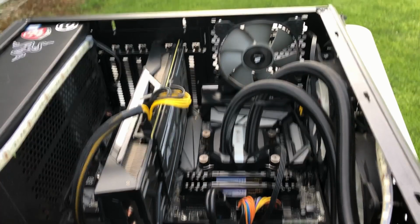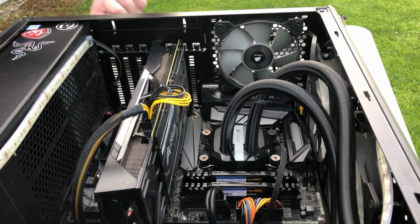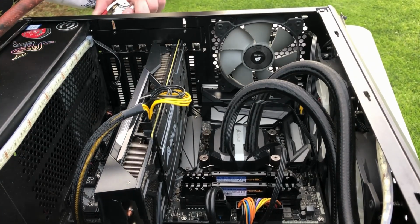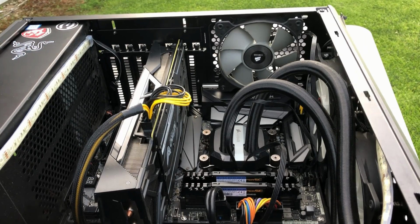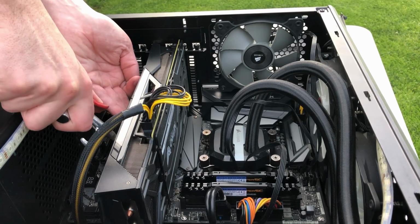So here I usually take the air compressor and go around the inside and the back of the fans and try to get into the power supply here. I usually stick something kind of small in to stop the fan from spinning in the power supply when I blow it out, so that it's not wearing out the fans too quickly. And I usually do the same throughout.